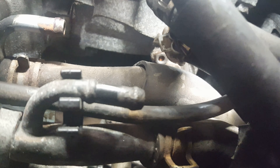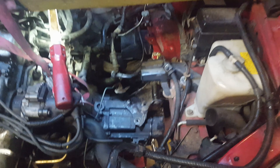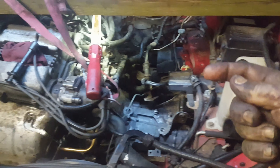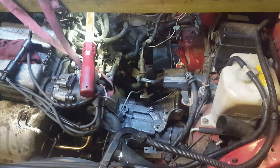The other thing I'm finding that the manual doesn't talk about is that this tube is jamming up on the flange of the transmission. If you follow it back, it goes into a fitting with two nuts and a retainer. I think you can see one right there. I've got one nut out and I'm working on the second one — hopefully that will allow that tube to fall forward.